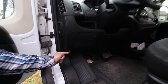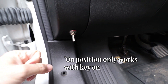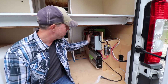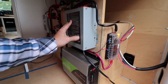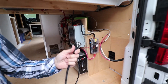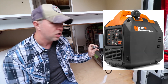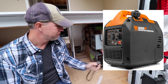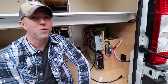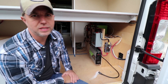Here's the switch I put in that controls the battery-to-battery charger. The third way — which I don't expect I'll be using that much — is an actual battery charger from Powermax. It allows me to plug into household power or a generator and charge up the batteries that way. So I have three different ways to charge the battery. I'll put some of these links in the description — I bought most of this stuff off Amazon.